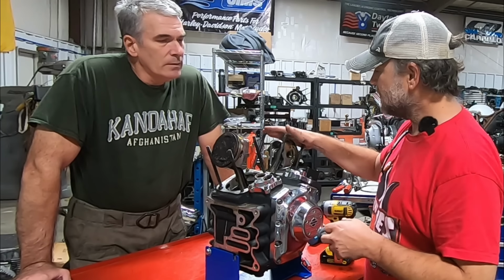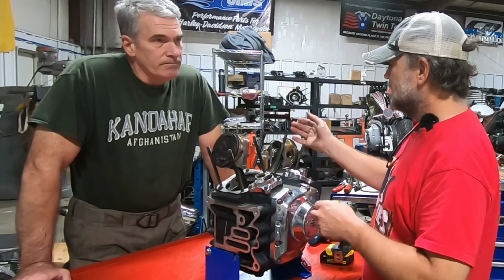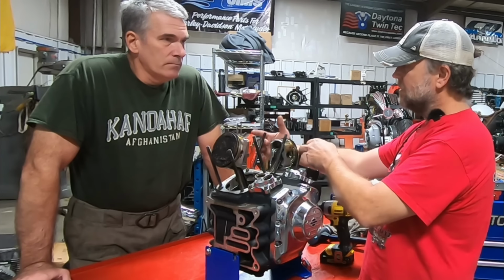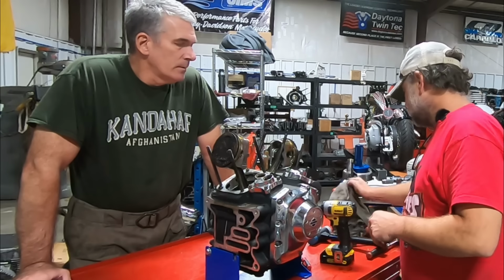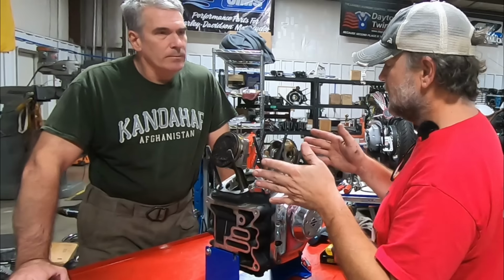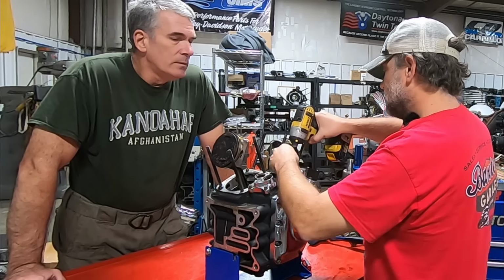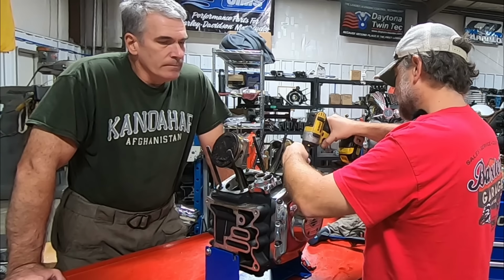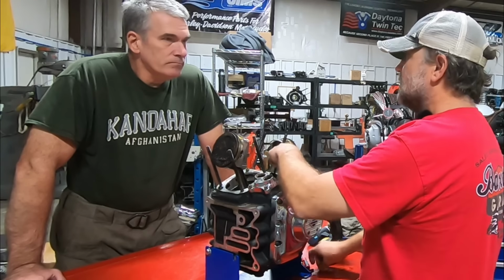But we've got four studs here. So when you cinch down on this cylinder, it's not unusual to see a little bit of a gray area on an engine that's got some miles on it, a little bit in those areas. It's more prone to cylinders that aren't perfectly squared up on a lathe. But stuff like that. Sometimes people panic when it's relatively small issues, and sometimes issues can be rectified without having to spend a ton of money.